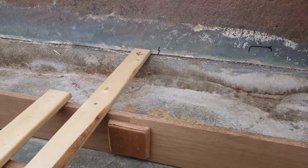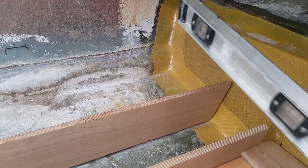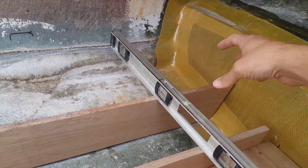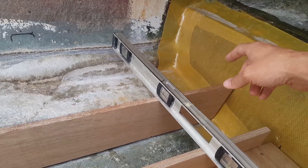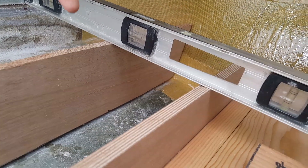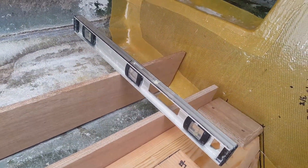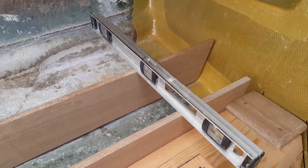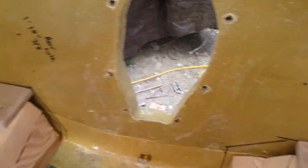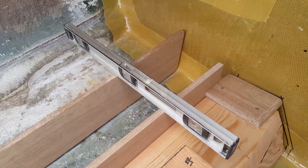As you can imagine, the water as you're racing will try to move to the very back. If you keep the floor completely level even back here, it's going to try to pull water into that corner. What you want to do is when you're cutting your stringers or when you're putting your fiberglass, try to get yourself at least a half a bubble where the water runs towards the bilge area. Try not to make it perfectly level back here because you'll have water pooling in that back — it makes for grime, and that's where most people put their battery. Over here you have your fuel cell and you just don't want water lingering around back here. You want it to run downhill into the bilge area.